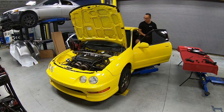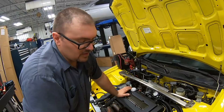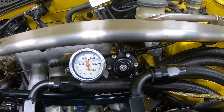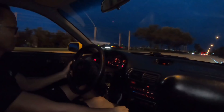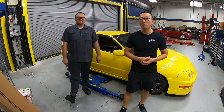Everything's back together, let's crank it. Everyone in the shop — even me — thought it was going to be the tensioner pulley on the timing belt. Totally off. It was all in the crank pulley keyway. We got it all worked out and things sound great. Man, it's nothing like getting a turbo car fixed. The test drive after fixing it is definitely the best part — turbo cars are addicting. If you guys like the videos, make sure you hit the subscribe button and share the video with your friends and family. Thank you so much for watching, hope to see you guys on the next one.